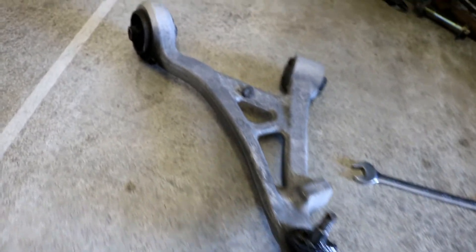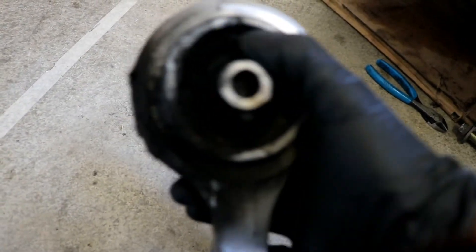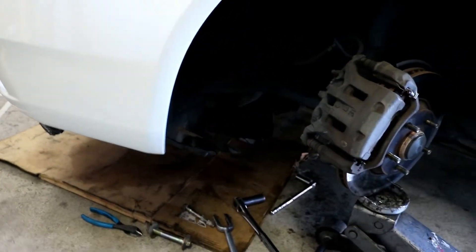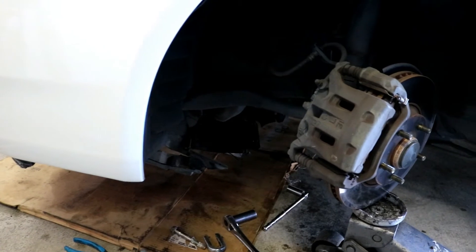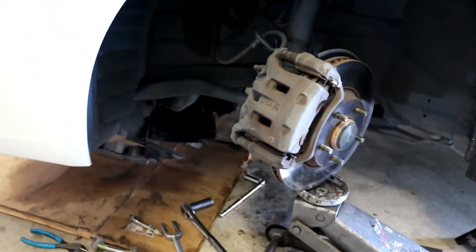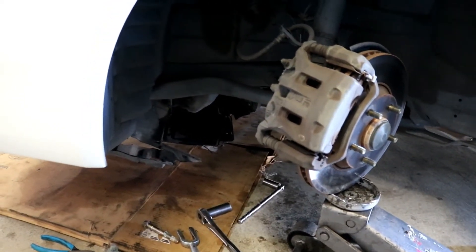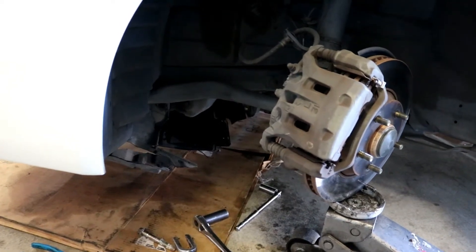You can see I got the bolts out and here's the old control arm. The new one comes with the ball joint, so I'm not worried that the old one is broken. As you can see, the control arm bushing is just broken. I'm going to wiggle the new one up into place, get the bolts in there, then swing it up toward the knuckle so the ball joint fits on. Just take your time getting it fitted into place.